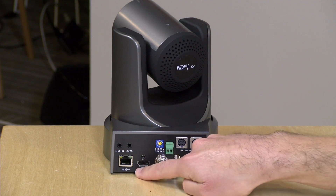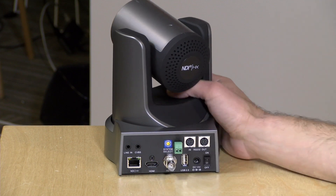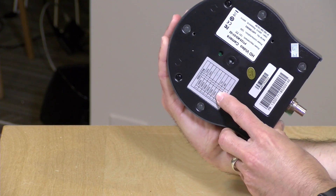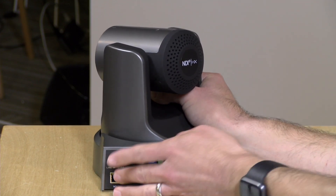What's really cool about the HDMI output is that it's capable of 1080p 30 frames per second — and that is a true 30p output. A lot of cameras don't support 30p out of HDMI. The camcorders I had before were outputting 1080i, which gave us interlaced video resulting in jagged edges and quality issues. This gives you progressive 30 frames per second out of the HDMI port, which is not common. You can also set other resolutions, and the max on this camera is 1080p at 60 frames per second. Right here you've also got your Ethernet port.